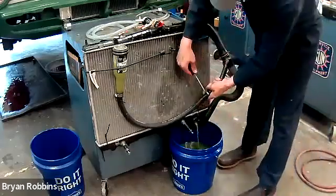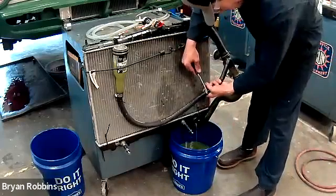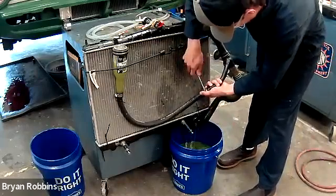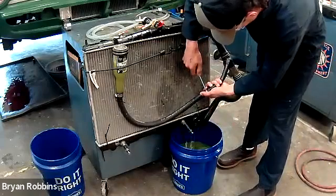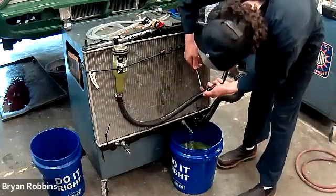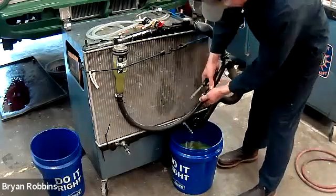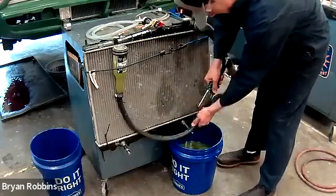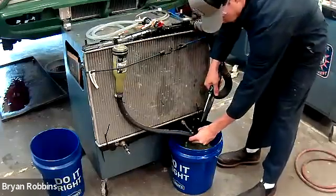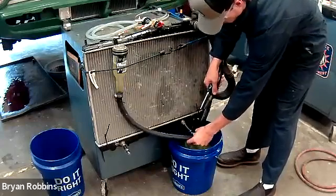He's going to get the system drained and also remove the extra drain that holds the coolant up in that bottle attached to the system. The reason that bottle is attached is because we need to simulate all the air pockets that can be found inside the engine, and it gives us a way of seeing whether the coolant actually went back in. There have been thousands of cars out there that have blown engines because they weren't properly refilled with coolant.